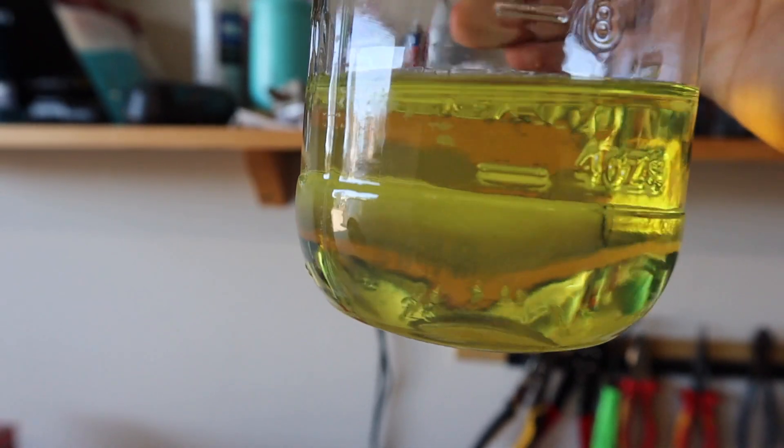There's nothing in here, which is a good sign. You never really know the fuel quality at fuel stations when you fill up, but what you can do is drain some fuel every oil change or once a month — regulate your own schedule. That is the absolute last thing you want in your fuel system. There could be thousands of dollars incurred if water gets into your system and affects the CP4. Just stay away from low-volume, sketchy fuel stations, and if that means filling up earlier than usual, go ahead and take that precautionary step.